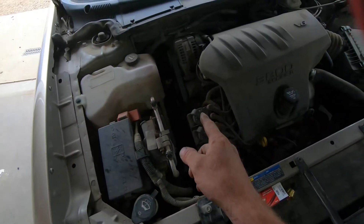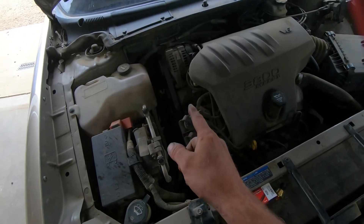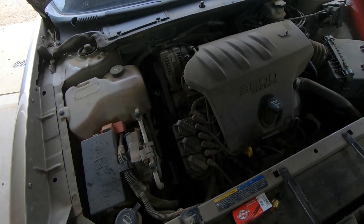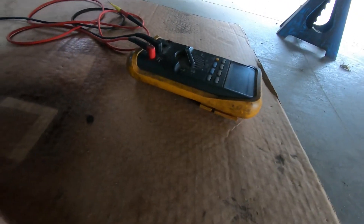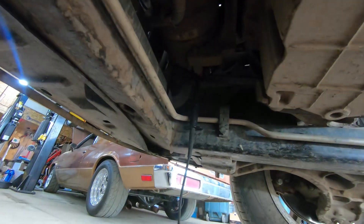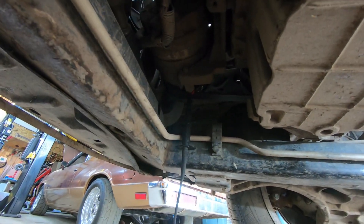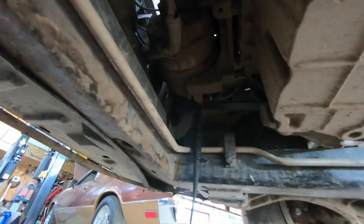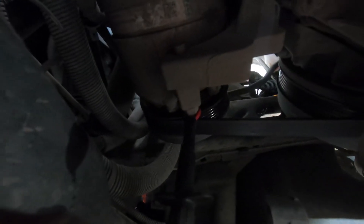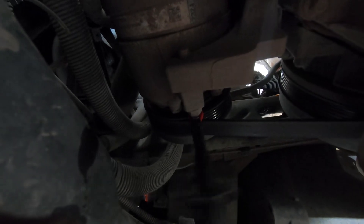So let's get down to this one, and we're going to show you how to measure and test for these three signal wires to make sure they are all correct. I have my voltmeter down here - I'm on the floor, I don't have room on the hoist. I have the ground on what I feel is a good ground. When you put something on a bolt like this, make sure to work the terminal back and forth while the clamp is on there - it will make sure to give it better contact.